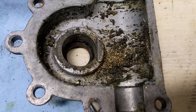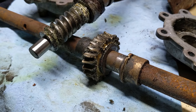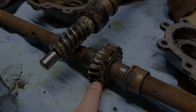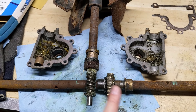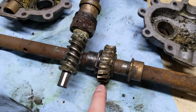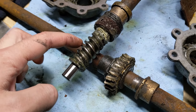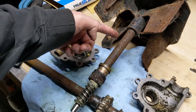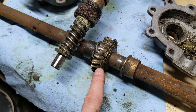You can see all of the shavings in there. Come down to the worm gear — this is soft metal. What happens normally if your shear bolts don't shear, that rotational power transfers down to this soft metal, which they call yellow metal. It's softer than this hardened steel worm shaft. This is your impeller shaft with your upper gear, and here's your worm gear down here.